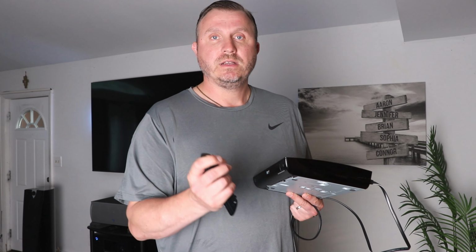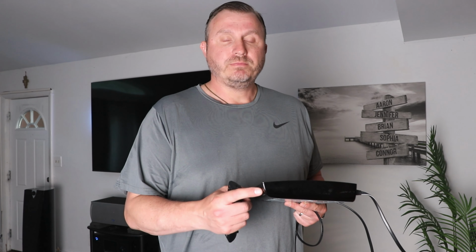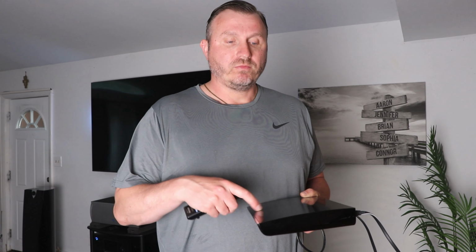And the basic gist of this whole thing is that it's going to read the SACD, use a custom script. Oh, by the way, there's also a USB port on the front, so you'll need a USB port. So you're going to use a custom script loaded on the USB thumb drive that you're going to make. When you put the thumb drive in this port, it's going to start a script that's going to run in the SACD player. It's going to serve the files up over the network to your computer, where a program is going to run on your computer to read the files from this file server that's running on the SACD player, and it's going to be able to read it sector by sector and pull down the files to your computer.